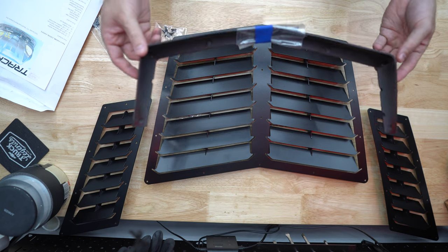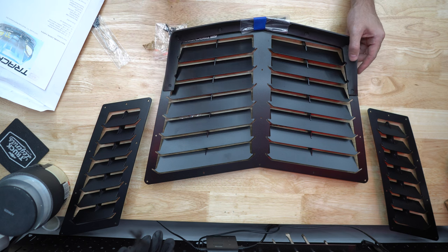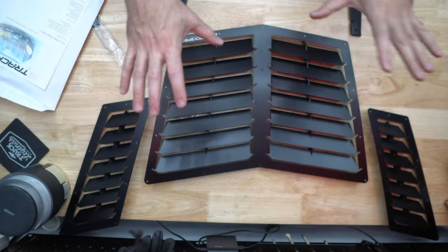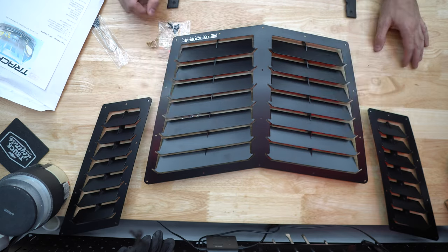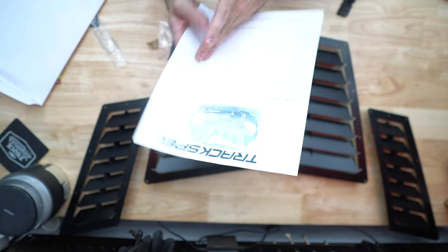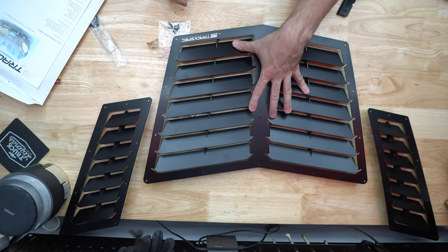And then the last bit is the wicker bill. It sits right here at the very bottom. This has proven to increase the airflow quite substantially — I don't remember the percentage off the top of my head, so I'll add that in the description below. I will say 90% of the Corvettes I see running are running it without the wicker. Aesthetically, it looks far better without it. I noticed this is held up by standard bolts while this is actually riveted onto the hood. So I plan to potentially just run the wicker for track purposes, and then aesthetically when the car's out on the road, it'll probably just be this setup. For today, I'm just going to install the louvers — not really going to worry about the wicker just yet. They do come with instructions — follow them front and back, measure twice, cut once, because there is no going back when you make these cuts on the hood.